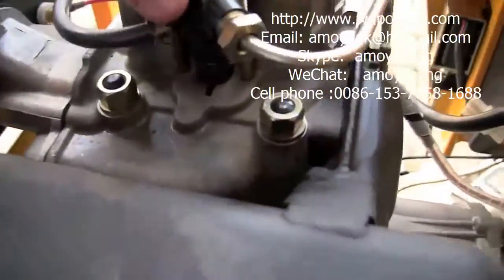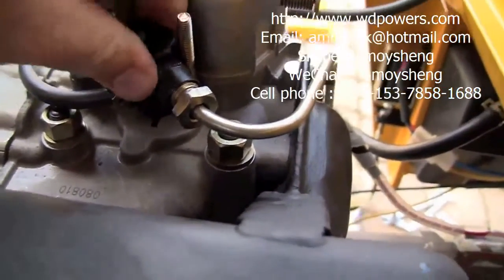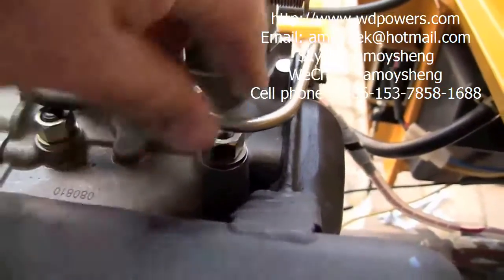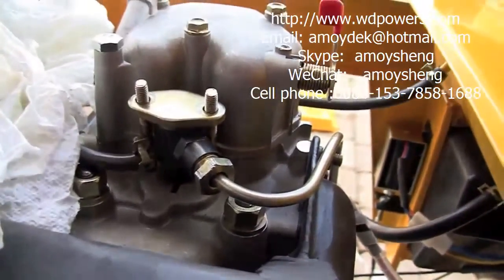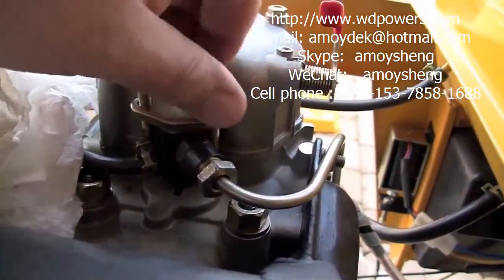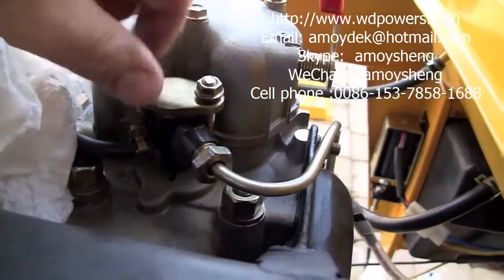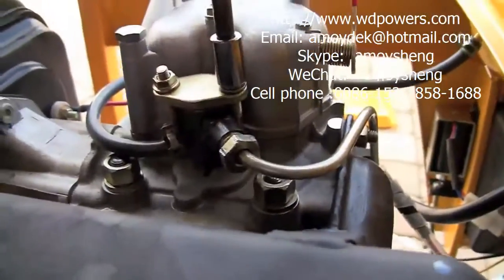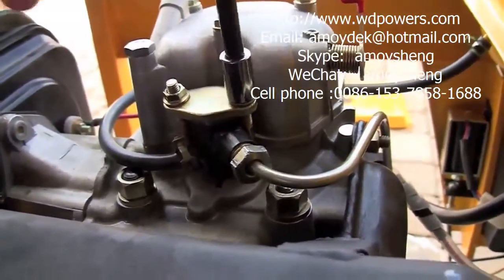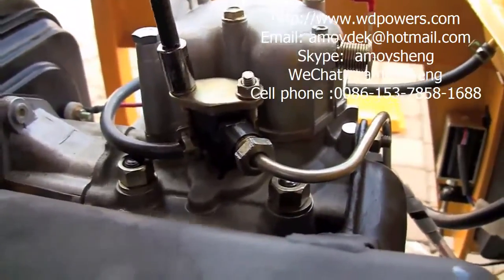The metal fuel line you can bend as much as you want. But when you put the fuel injector back in, make sure those copper washers and that insert haven't fallen out. You're not forcing anything — there's a pin to line it up. Everything should go back into place easily and you should be able to finger tighten it. Notice how much room is left on the threads here so you know whether you've inserted the fuel injector properly. It's not forcing down or it might not be sitting properly.